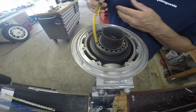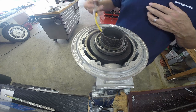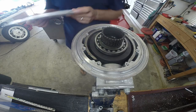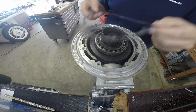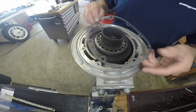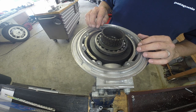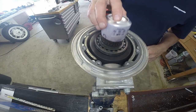Same thing with the ring gear — you can see from disassembly it just sits down in there. Now I'm oiling up the bearing, putting a new gasket on. I had kind of forgotten that gasket only goes one way, so it took me a second staring at it — oh yeah, goes that way. That bearing fits on the aluminum cover, so you have to heat it up.